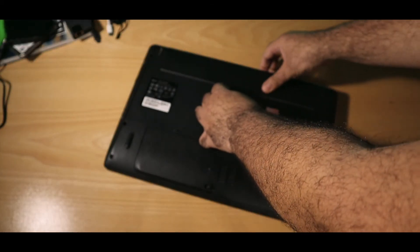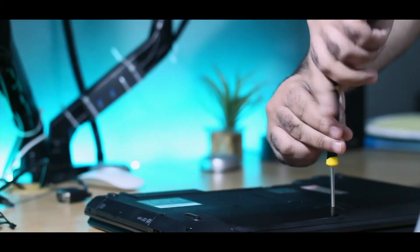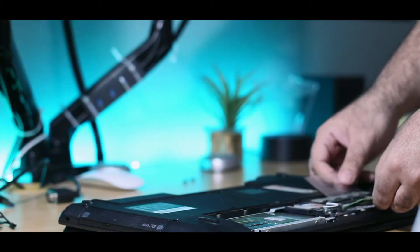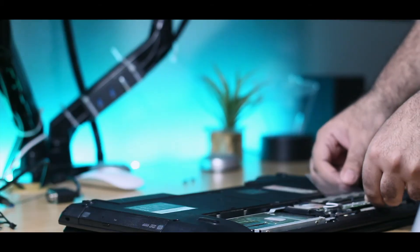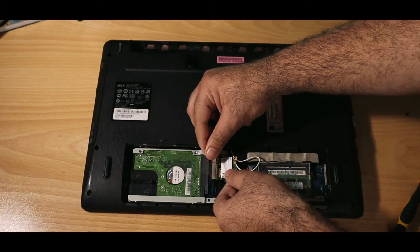To explain the process: I did a backup of the Windows 10 system, the system was shut down, and the battery was removed, which allowed me to get into the back of the device. There are two screws holding the laptop in place. I started off by replacing the RAM, taking it from the 2 gigabytes it came with and putting in a 4 gig DIMM. Then the wireless card got replaced with a dual band wireless card.